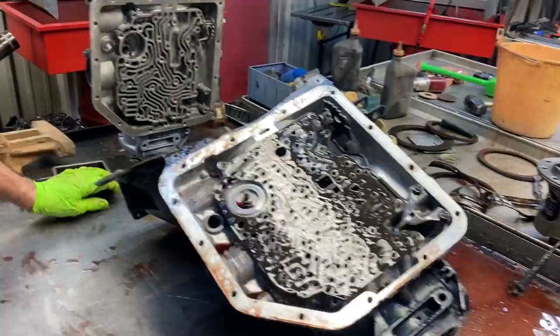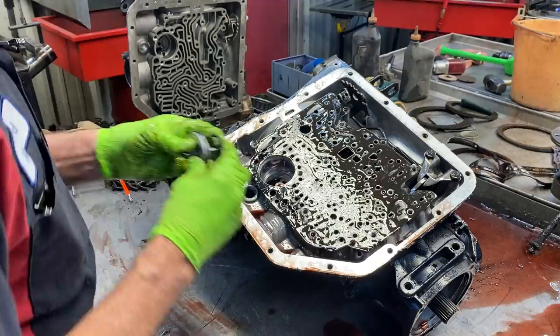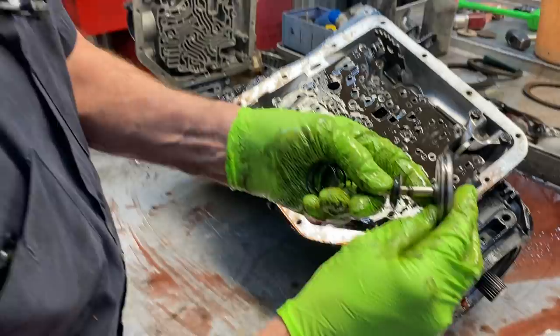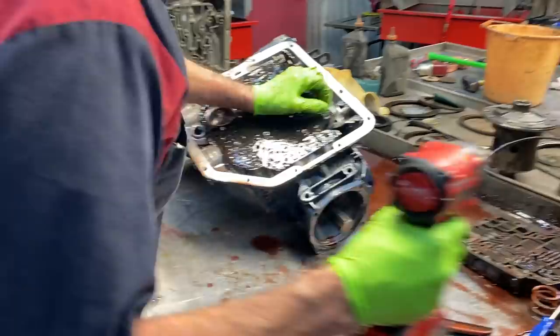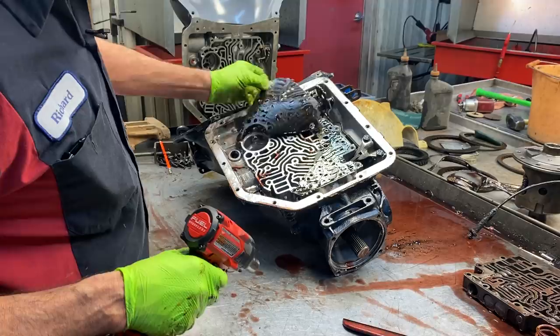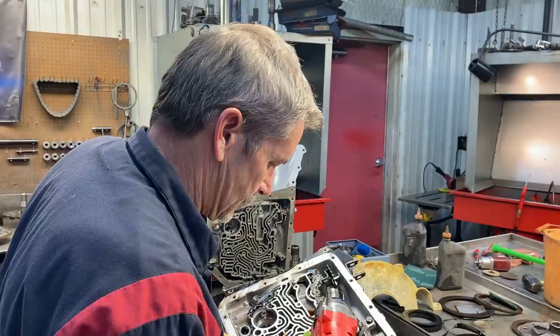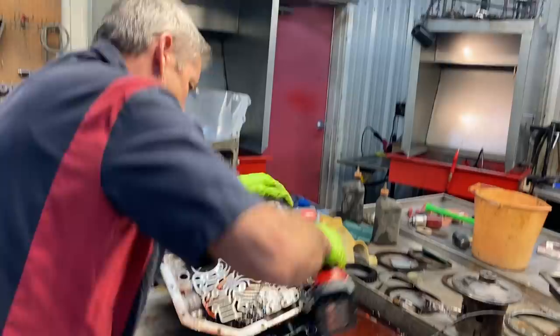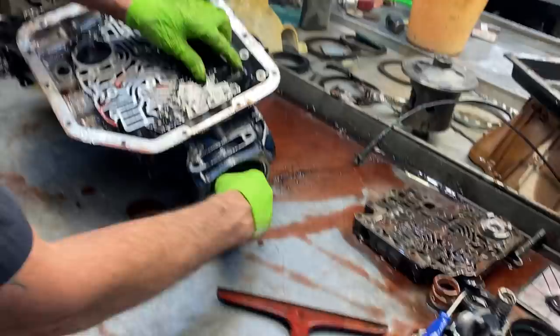You have your engine brake servo here - it applies your engine brake band. Pull it down into second and you get that braking feeling; that's what comes on right there. There's a little washer under here that you can lose, so be careful not to lose that. Sometimes you have to put it in an instant clean machine to get the gaskets off - water is what usually sticks them. You can just tell there are some you can't even get off half the time. This is your park linkage - pretty simple. It moves the lever here and just locks it into park.